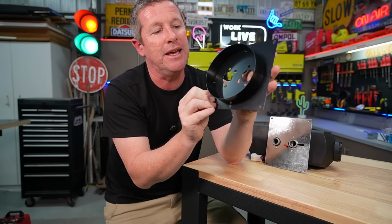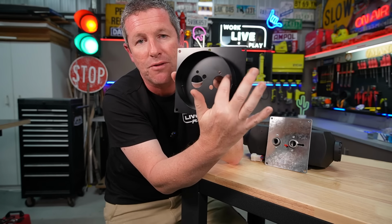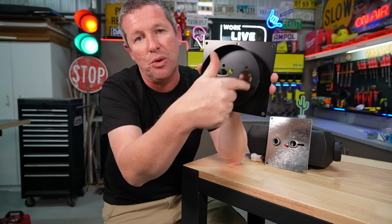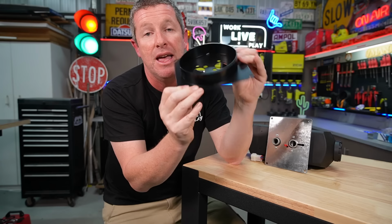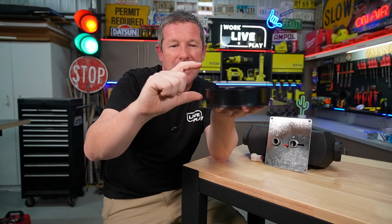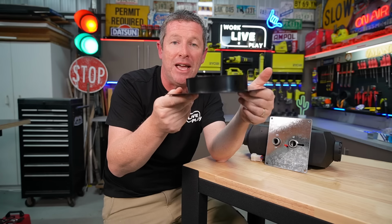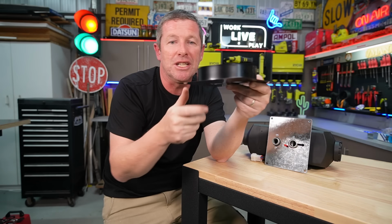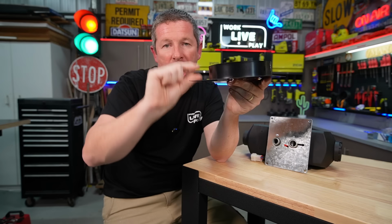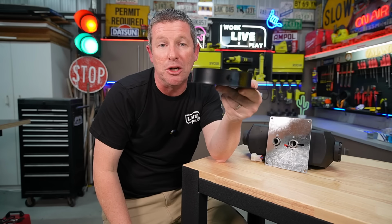So if you're looking to buy one of these, there's a few different styles out there. Firstly, get the one that doesn't have that little slot off to the side. And then if you want to, there's newer ones out there that actually cut all this out to make it easier to fit everything in. The other thing to consider is quite a few of them will have a 30 mil or a 70 mil, I think, sort of collar that comes out through the bottom. Now, if you're installing this into a typical Australian Caravan or camper trailer, it doesn't have a real thickly insulated floor, we've just got a plywood floor, you only really need the 30 mil. And that's just to provide that transition from the floor to the underside, so you can seal it all up and make it all look nicey nice.